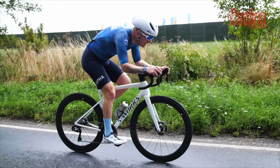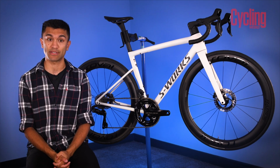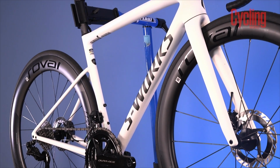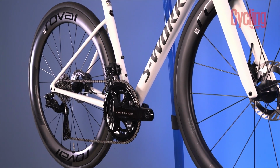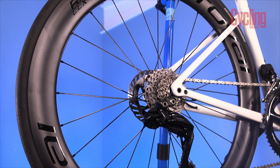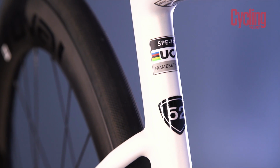So, while it is a great weight for a top-end bike to be, the progression maybe isn't quite all it's cracked up to be. The only thing that does leave some intrigue to the weight is that there are some very obvious places where more weight can be dropped out of the full build. Simply dropping the inner tubes and then adopting a tubeless setup would probably save you about 100 grams. And, I mean, if you've got a lot of money and you wanted to buy a carbon THM chain set, then you're only going to compound those results. Put it this way, I think that a number of the customers for this bike will be looking at it as a project bike. I will not be surprised if we see custom builds of this bike hovering around the 6 kilo mark. But of course, frame size and paint will play a big part in this.